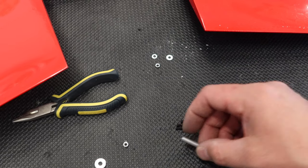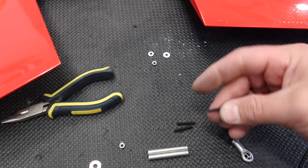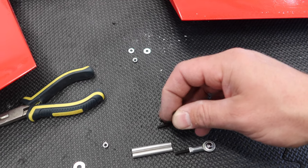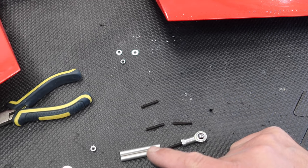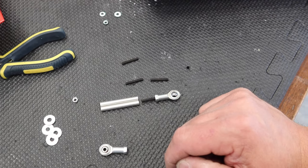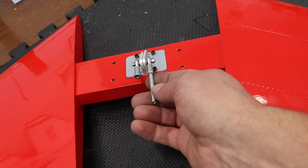The control rods are made up with an aluminum tube that's threaded. These get threaded into the ends — there's an Allen key on one side and not on the other. We Loctite these into place and then thread our ball joints on too. Use red Loctite to thread these guys in, and then blue Loctite when threading the ball joints in. That way if we have to take them off, the ball joints will come loose before the threaded piece inside the rod.